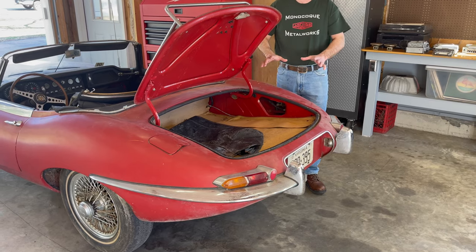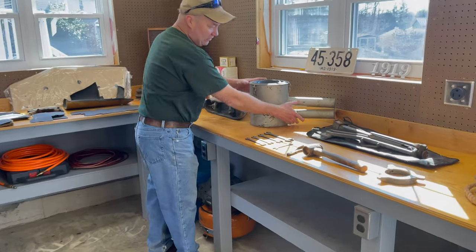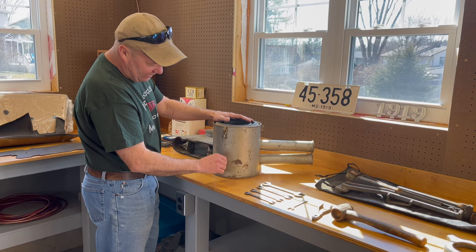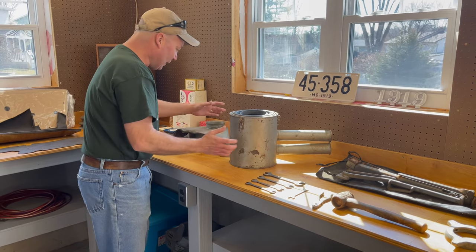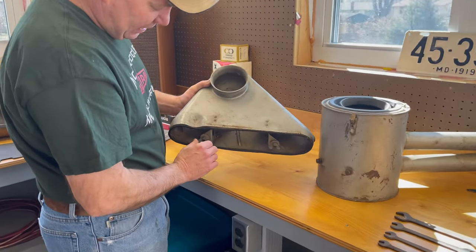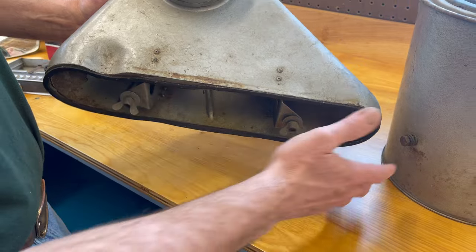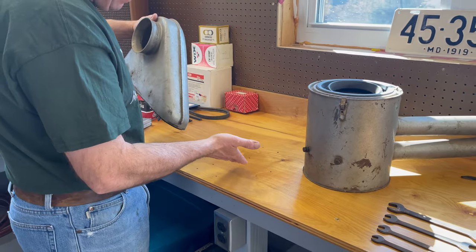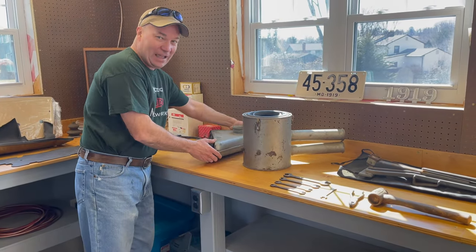Another thing: when I picked up the car, the air cleaner was off and out. Now this is the original air cleaner assembly. It's just pulled out — this is the original condition. It still has the original bolts with the flat washer and the star washer; none of this stuff has been lost. And here's the fiberglass plenum — it still has the original washers and the original wing nuts. They call these mouse ear wing nuts. This is the 4.2-liter style, so it has the ribs in it. Look — there are some mouse droppings that just fell right out of it. Hopefully we don't end up with too much mouse damage in the car; I haven't seen any yet.